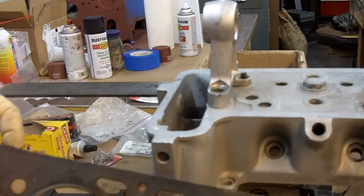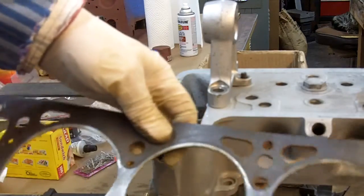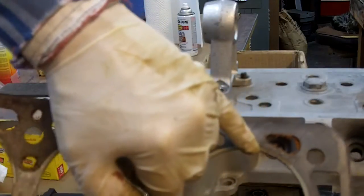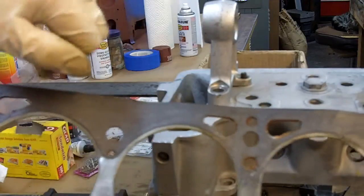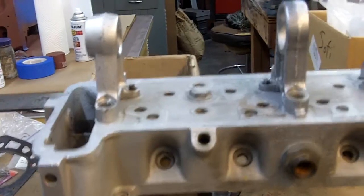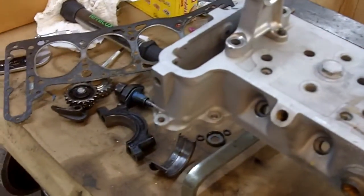You can read the head gasket to see if the head, block, and gasket were leaking. What you're looking for is the fire ring to be real shiny, bright, silvery looking — where it isn't shiny is where you had leakage. This dark spot here indicates leakage. All in all, this engine was a testament to how to screw up the rebuild on a 190SL engine and make it more difficult for those that come behind us.